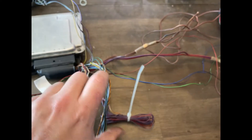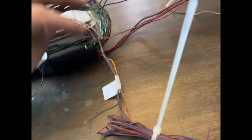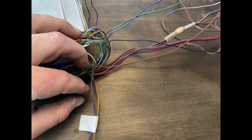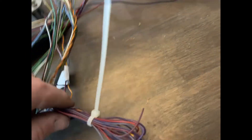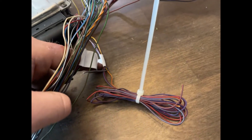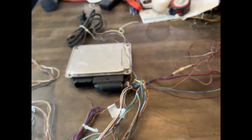There are also a couple more deletions. These are the bundle of wires I've deleted out currently. Some were automatic transmission wires — there's a yellow-red, a couple of grounds, a purple wire, and a solid gray wire. Some of these might be cluster wires that drive the cluster. I'm leaving these a little longer in case I need them — don't want to cut them too short, as it can be a pain to splice everything back in.